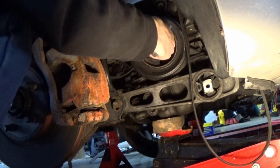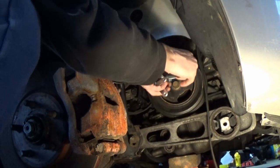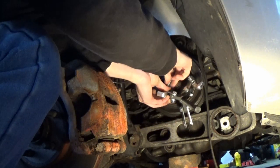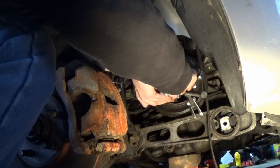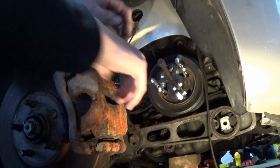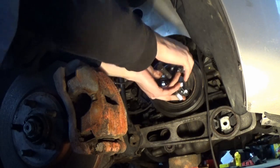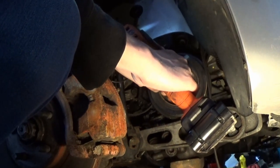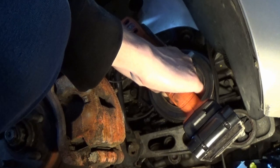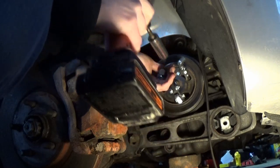And basically, the reason why I partly took this apart is because I couldn't fit all the arms in with it all together. So I'm gonna kind of feed this arm in. I'm gonna go ahead and put this one in and bolt it onto the puller. Kind of a pain in the butt way of doing it, but it works. It'd be nice to have a special puller that's a little bit smaller, but they're a little hard to find that are smaller than a 4-inch. All right, now that we got all our arms in place, you can see what that looks like right there. We should be able to start pulling on this, and hopefully it pulls out easily, but we shall see. Okay, started pulling for sure.